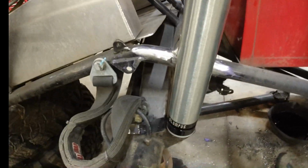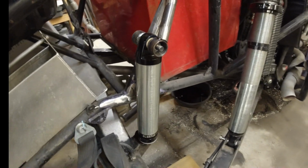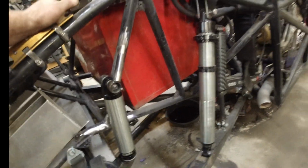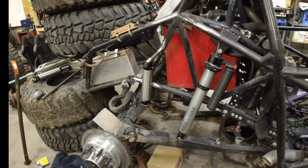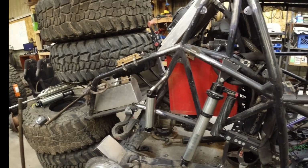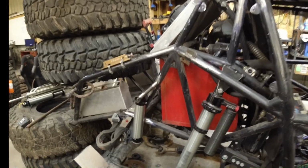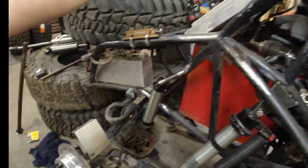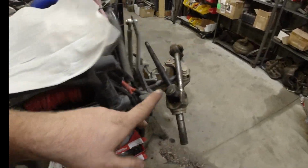I've got to pick up tube for that lower clamp can tomorrow. But this is how the bump is going to mount. So that'll be there, and it's going to be a big bump stop. It'll definitely help with dampening and give us that much better ability to tune this rig in. So I've got to make the other side. I'm just trying to give you guys some updates on what we've got going on. We're going to knock out all the brake stuff, the bumps, get this rear suspension dialed in. We got to knock out the front brakes, finish these on both sides.